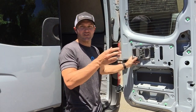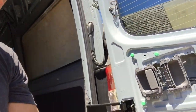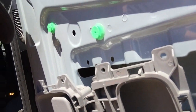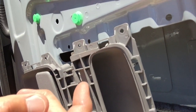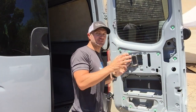Like anything trim or interior, it's just a bunch of plastic snaps. With that trim surround, it notches into these things here — you see the little ramp back there. So it basically goes in and clicks over that. The hard part is you've got to kind of get under there and lift those tabs up. I use a long dental tool, or you can use whatever you want. It's a little bit fiddly but not all that difficult. Let's jump ahead — you've already got this off.